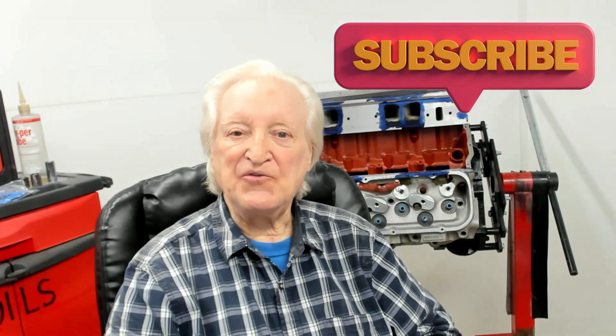Here's the problem with two-plane manifolds. Edelbrock does a great manifold, but there isn't a carb that will fit it with enough flow. Their intake manifold flows a lot of air, but then you stick a 4150 series carburetor on there and the best you can do is about 1000 CFM — and that's just on the limit. Really, what Edelbrock needs to do — please note, you guys at Edelbrock — is make a two-plane manifold that takes a dominator. A 632-inch build with a dominator on a two-plane would be just an awesome street driver: pull from low down and make good top end. But anyway, that's another subject.